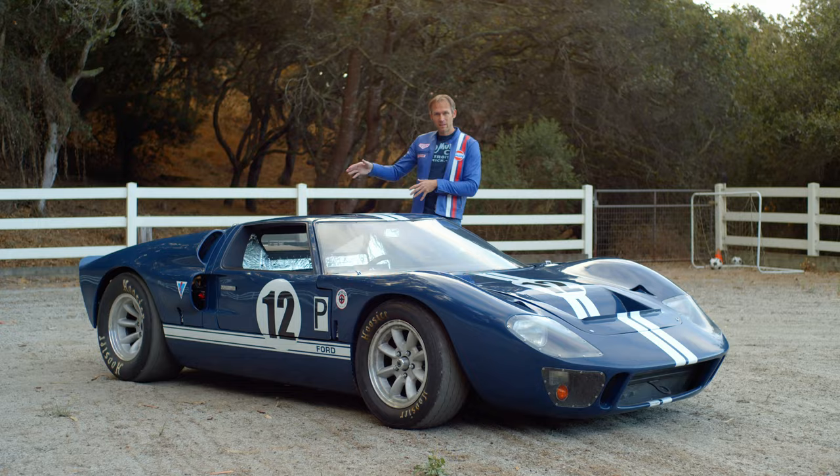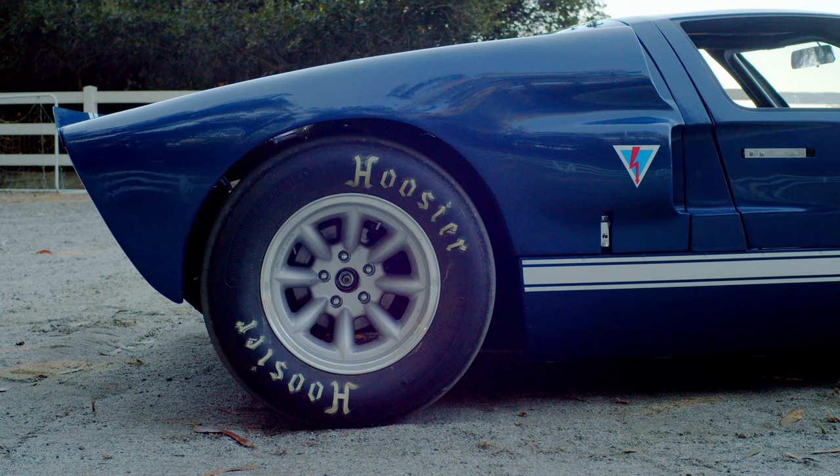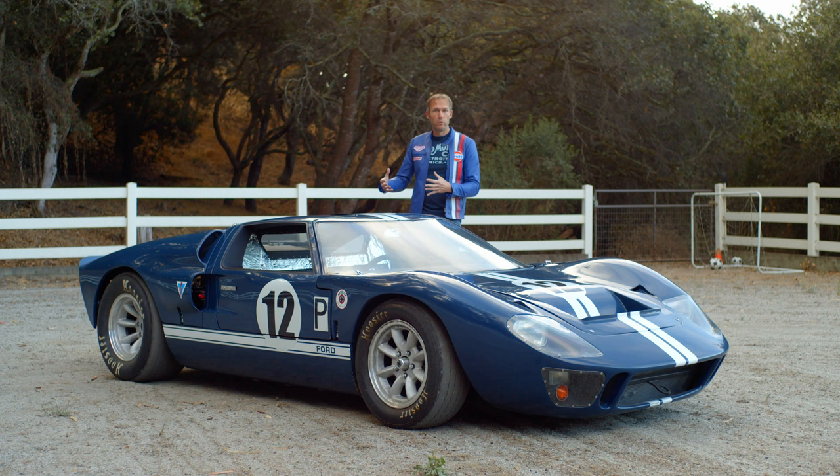The other big thing I did after Crows Landing was redo the rear suspension to get the wheels centered in the rear wheel wells. This goes back to a mistake when fitting the body — I adjusted the wheel well location based on where the wheels were at that point, not realizing the rear wheels weren't in proper alignment. I had so much toe-in that when I put the toe back to a reasonable setting, the wheels ended up a half inch further back. I made new control arms, and now the wheelbase is the correct 95 inches, which should go nicely with the planned engine relocation — moving it down and slightly forward.